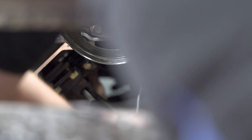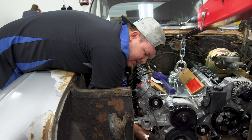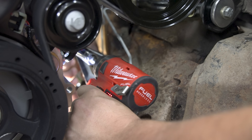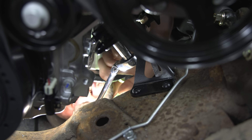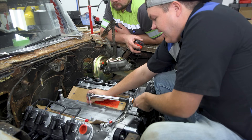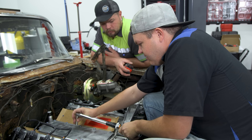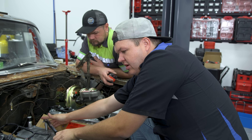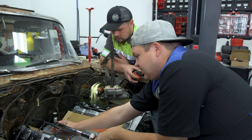Passenger bolt started in the motor mount. The driver's side, we're having a little bit of an issue — we've got things a little bit cockeyed. Hillbilly's down working on that. So we got both motor mounts in. Now we've got to figure out how to get the cross member in. Starting to tighten up all the bolts we had to loosen. Hillbilly got the bolts all tightened up on the motor mount, except for the actual motor mount bolt. We'll leave those loose until we have the cross member in so if there's any movement that needs to happen, we can move it.